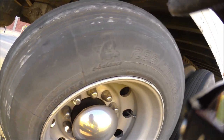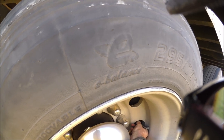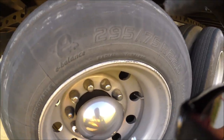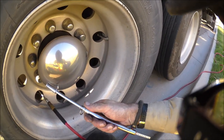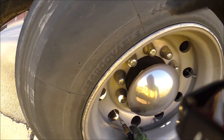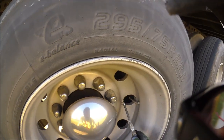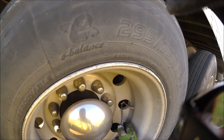The air compressor in the tractor stops right at 120, so every time it stops you hear the air dryer go off and you know the tanks are all at 120. Then you can just leave it and walk away. I've got 80 to 82 on this one, so I should fill this one up too. With 18 tires you've got to keep an eyeball on them all the time, or you're going to wear them out. These tires will nickel and dime you if you don't do it right.